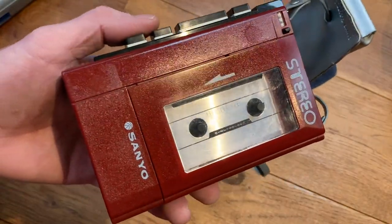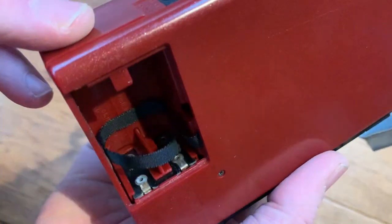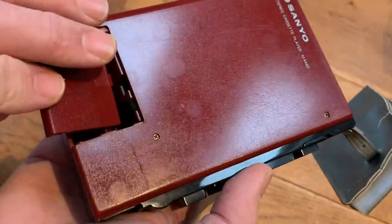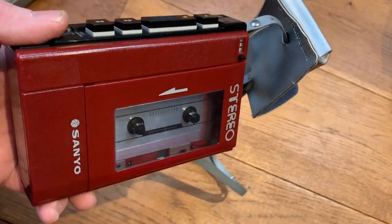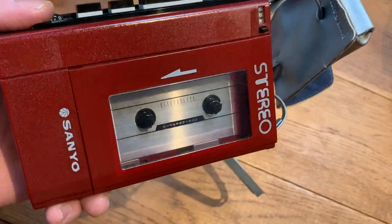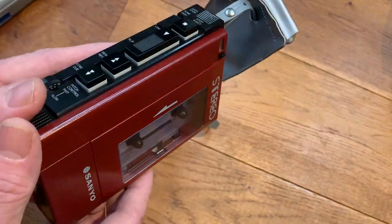It's not been used for years. The battery terminals are a bit corroded but not too bad. No doubt the belts will need replacing — I know belt replacements on these do require a lot of desoldering of the board. That's going to be a bit of a job, but I've got about half a dozen of these, or similar ones without the counters, so we've got a whole batch that we'll be repairing at the same sort of time.